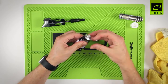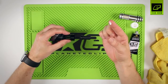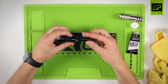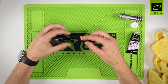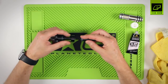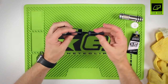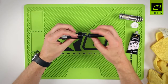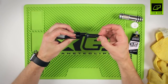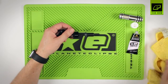For basic maintenance of the prop shaft, all you're going to need to do is take a very small amount — about half a pea size — and apply that to the 14 by 2 O-ring on the front of the prop shaft. Smear that around; you're just looking for a small amount so that the grease is visible around the O-ring. There doesn't need to be any excess around the tip of the prop shaft or behind it — any excess left can just be wiped away.